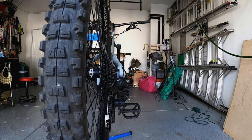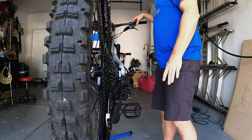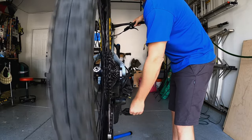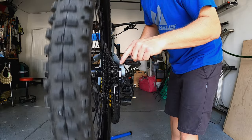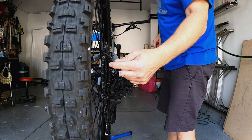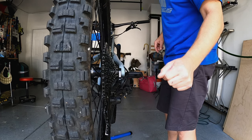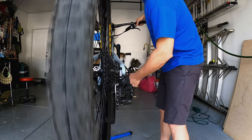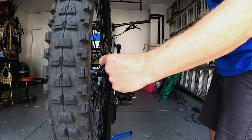We can reproduce this — here's the extreme of having a way over-tight cable. The barrel adjuster is going to quick-spin out a few turns. Notice we've already moved up a couple of gears. When I try to shift up into our largest gear — that works fine — but notice this is actually the highest gear we can get into. There's actually one more gear on the cassette, the 12th gear, that we're not able to shift into. If we tightened it more and the low limit screw was not set correctly, the chain would tend to slip off between the lowest cog and the spokes. We should be in the highest gear on our cassette but we're not — we're in 11th gear — so the derailleur guide wheel is not able to align to the smallest cog on the cassette.